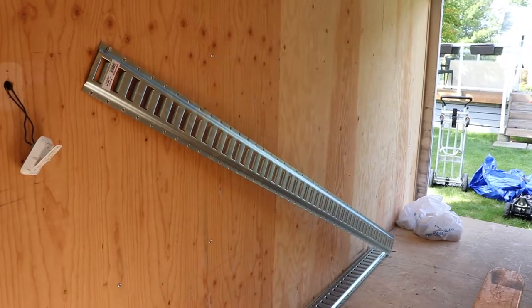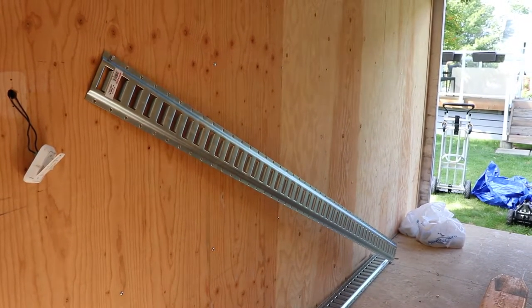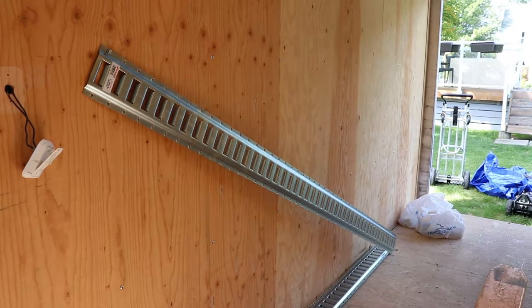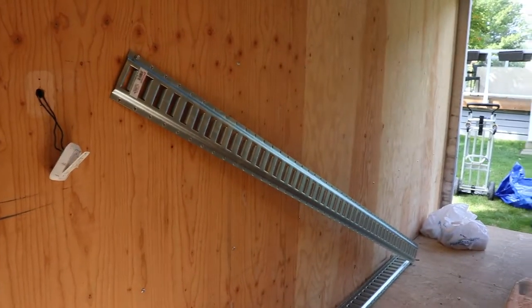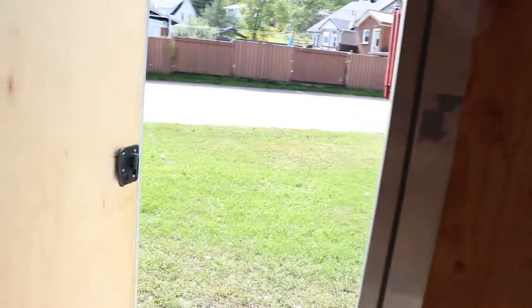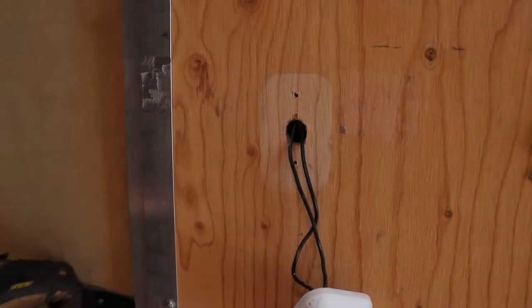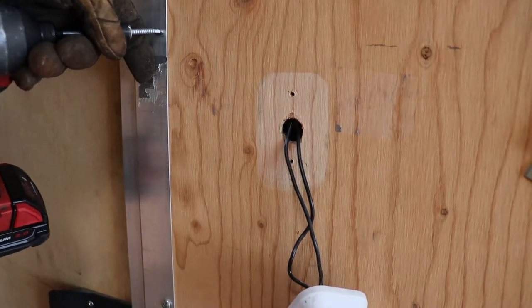I'll have something around 28 inches to the screw on the bottom and 48 to the top of the second row. I've got eight pieces of track here — they're rated for 6,000 pounds each so the rating is no concern. I kind of want to put the weight of the load nearer to the axles without having a huge amount of tongue weight. I'm going to put eight-footers from the door back on both sides, two rows. I've marked my piece here — light's a bit difficult — but I'm going for right here and I know the stud is there based on the way they put this together.